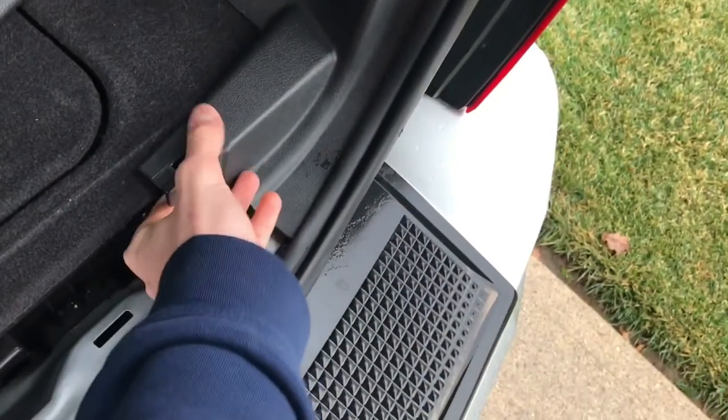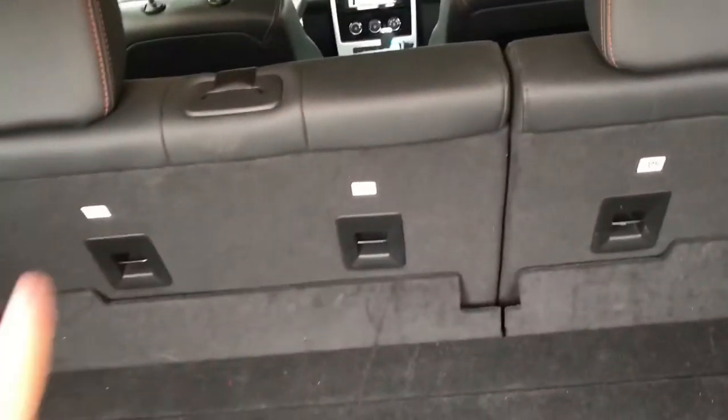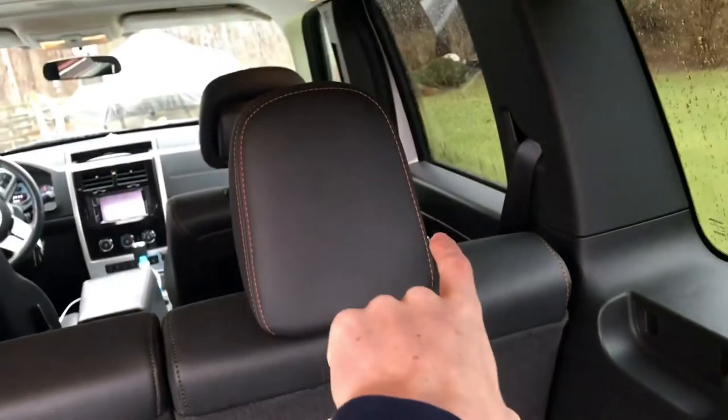What I suggest is grabbing this piece right here and pulling towards you this way, and then the same goes for up here. There's a panel that runs across the top — pull off this panel. Once it's pulled off, you can grab behind here and also pop it up; there are two clips on the inside here and some support clips deeper inside. Just start pulling and you should be able to pull them out. Make sure the seats are down — this makes it easier since this panel runs all the way to the front, halfway down in the kick panels and connects to the front pillars.